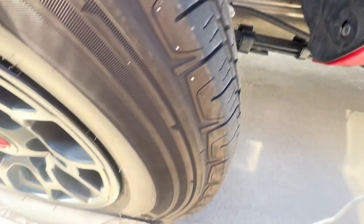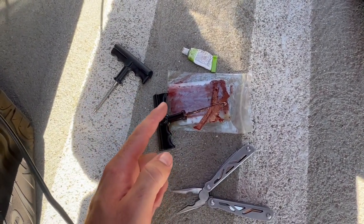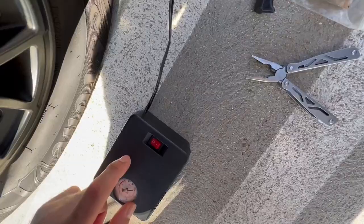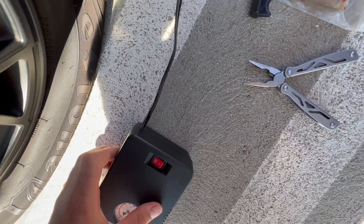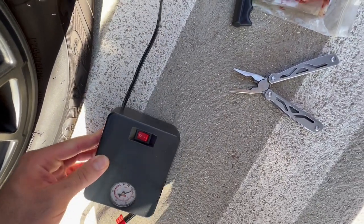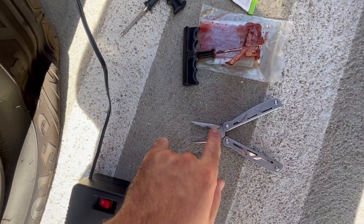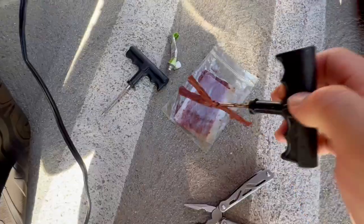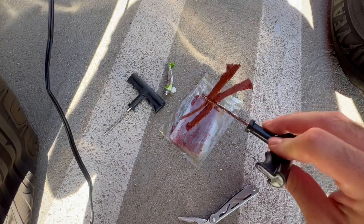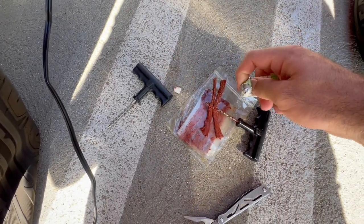Here's my tire at the moment. The things that we need are this tire patch kit — you guys can see I've used this plenty of times before — this plier, and of course a pump to fill the tire back up. I do have my portable one but I think this one will do a quicker job since it plugs right into your car. I'll go ahead and feed the plugs through. Because the patch is so big, I'm putting two of them and putting a whole bunch of the cement onto them.